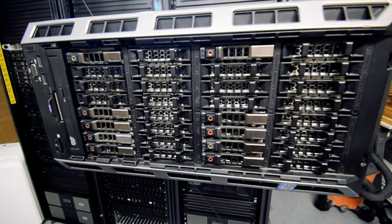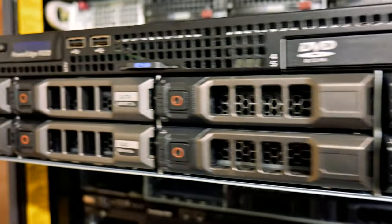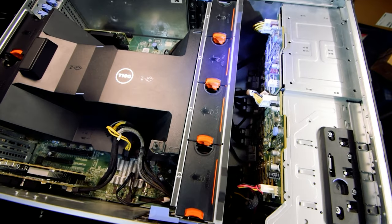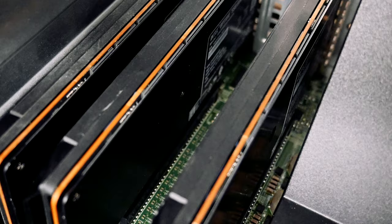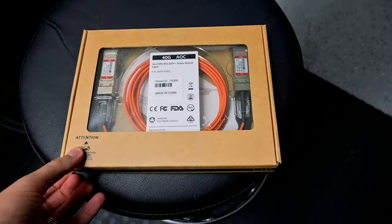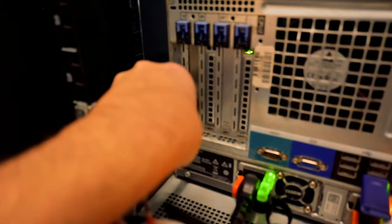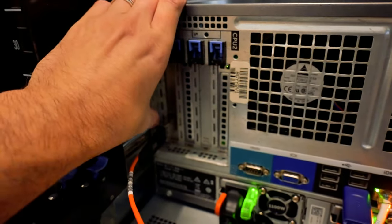Moving on to our Unraid-to-Unraid setup — this was way easier. In Linux, configuration of these cards is typically much less problematic. These cards are detected by the kernel and supported very well with no weird issues. Servers have lots of PCIe lanes with massive amounts of width, and Intel Xeon processors have tons of PCIe lanes available. A quick thank-you to our sponsor FS.com, who supplied all the cables for this video. Their active fiber cables coded to the Brocade and Mellanox cards have been easy to use with no headaches — check the link in the description for QSFP+ FDR-compatible cabling.